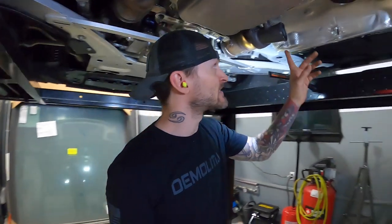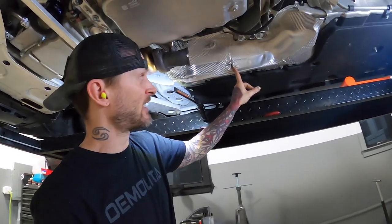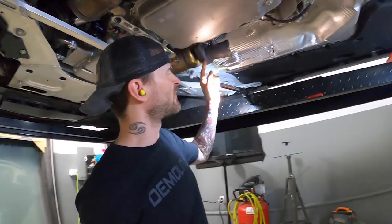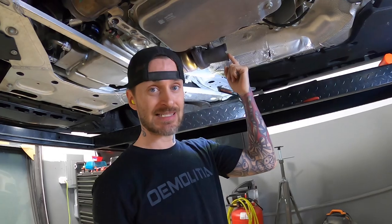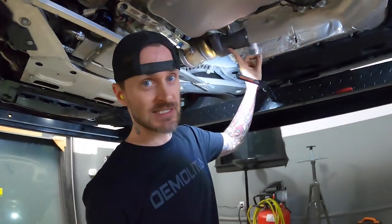The game plan is we cut this guy off very crudely because there's absolutely no space in here. I nicked the heat shield right here and this one here, but I tore this open because there are some lines back there and I want to make sure I didn't hurt those lines - and I didn't - so we're going to get some heat reflective tape and tape those up. Luckily the factory exhaust opens up to three inches, so we cut it right behind the weld where it opens up to three inches. We've got three-inch pipe we can accept onto this three inch right here. We just need to go to an exhaust shop and have them open it up a little bit so I can just barely slip it on, then weld it, and this little guy here just unbolts so it's real easy to 360-degree weld that.